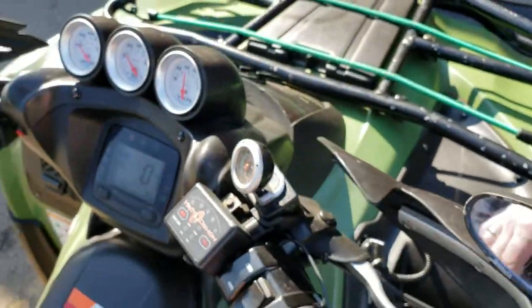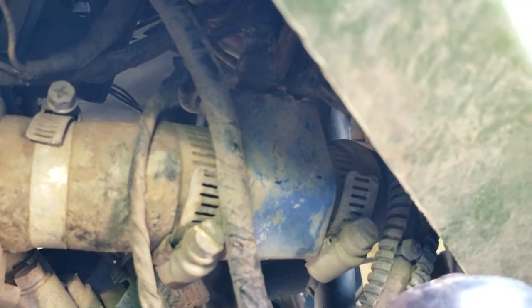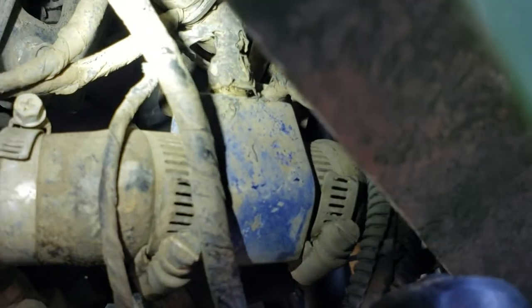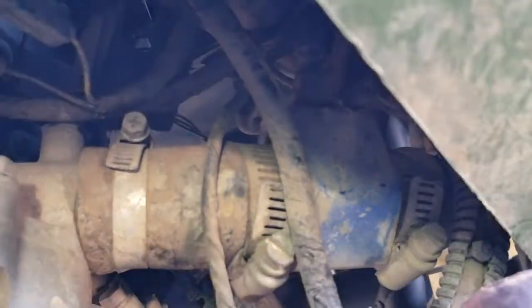The water temperature I had to buy online, supplies, which is you cut the hose, put the splice in, and on top of it there is a temperature sensor port, which you just screw in and attach some negative and positive and lead it to the gauge over there. And also you're done with that.